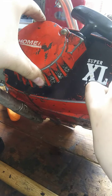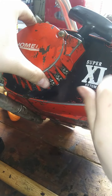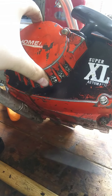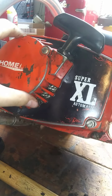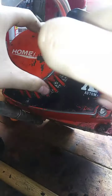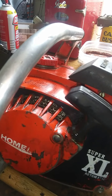Somebody's saying, why are you using it? There's a socket hex head on that. It's like a bolt. I need to use a screwdriver. I like to start them with a screwdriver, because I find it to be easier when you're starting them, and then come back with a ratchet and wind them in. That's why. Okay.